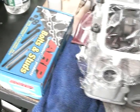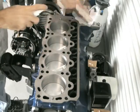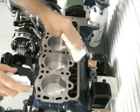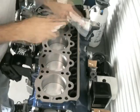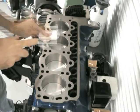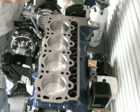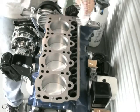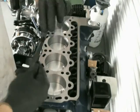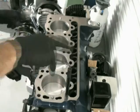Once that's clear, it's just a matter of wiping it all down and cleaning up all the faces so you're ready to put the head gasket on. The head gaskets for these engines are not that easy to find. I hunted around for ages and finally found an appropriate gasket that included the front timing cover section. It's one millimetre thick and appears to be very good quality, so we'll see how it goes.